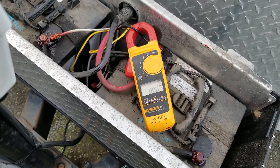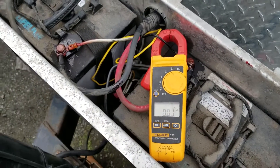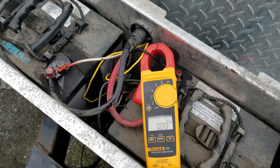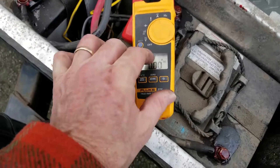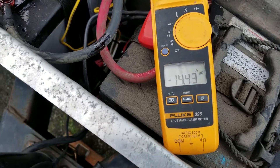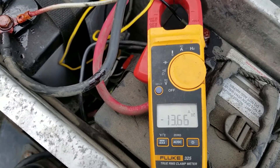As promised, one last test before we button up — I want to see how many amps are going to each brake. We know each brake consumes about 3 amps, and there are four brakes, so 3 × 4 = 12 amps expected. I'm at zero on my meter clamped around the plus wire. I'm going to pull the pin out — pulled it — and we are at about 14 amps. The negative sign just means my clamp-on meter is upside down relative to the wire direction, so that's about 13–14 amps.